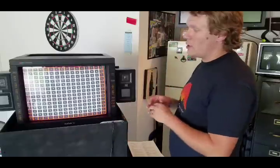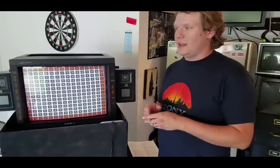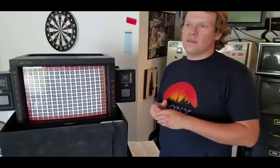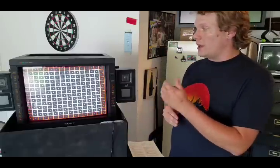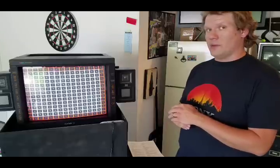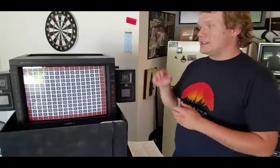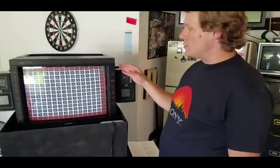Looking at the first grid, you can see the image is curved and there's a black space — we'll need to horizontally shift the picture to the right, rotate the yoke to straighten it, and adjust the corners. You can't make this look perfect; even the manual states these CRTs only display about 93 to 95 percent perfection. These earlier PVMs from the late 80s and 90s don't have the hardware that later models from the 2000s had. It's still a great monitor though.